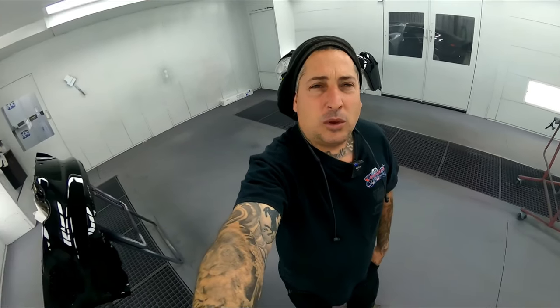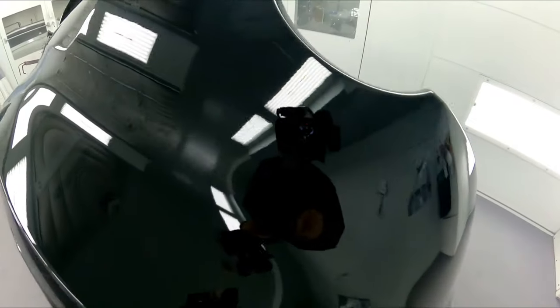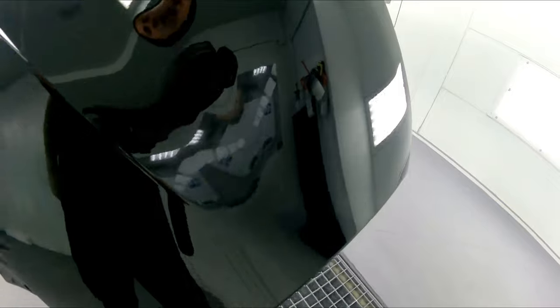So that 2021 has one hardener and then you can adjust it by the reducers that you have. We've sprayed some parts here with the 8150 that I was telling you guys about, and this is a really nice clear. It's a performance glamour clear and this one here was sprayed last night. It's got a nice real good gloss to it, and this one actually allows you to change the hardener and the reducer.